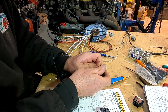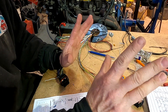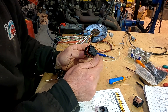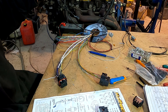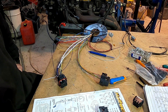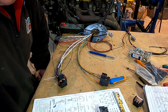One big trick is reading the instructions — that's really important. Understanding what you're doing before you start doing it. I took this information and I wrote it in a form that I understood, and that allowed me to work through and check that I had everything allocated before I started wiring. That means we get a better job at the other end because of the planning we did at the beginning — very important. So that's ignition done. The power supply to the coils is from the ignition relay through a fuse, very simple. If you're running different coils, wire them appropriately. If you've got coils that don't have igniters, you'll need to put an igniter in the system. That's ignition for now — we'll talk to you again soon, catch you later.